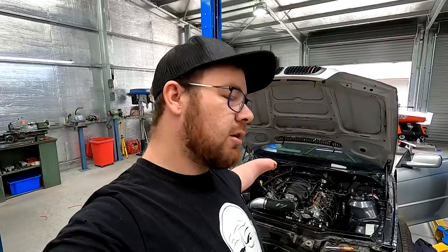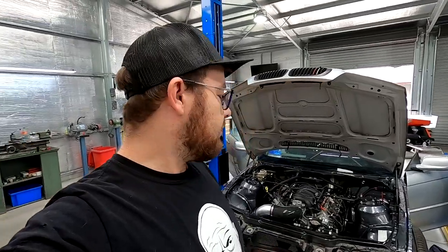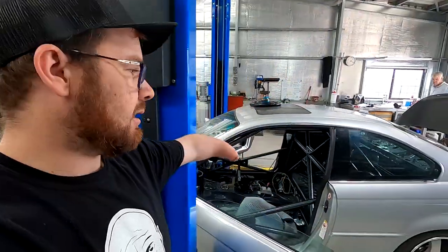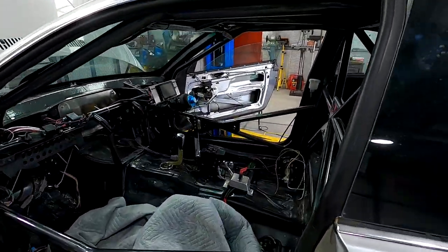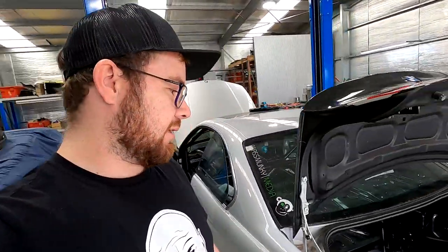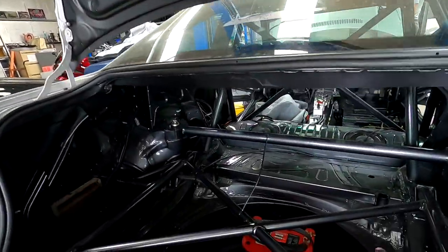It's going to the tuner tomorrow, so just little things — we're wiring in the alternator at the moment so we've now got 14 volts. We've got a battery, we've run battery cables through the car to the isolator switch. Battery is actually looking pretty neat. We still need to tidy up the power wire with the covering and the conduit but I'm pretty happy with it.